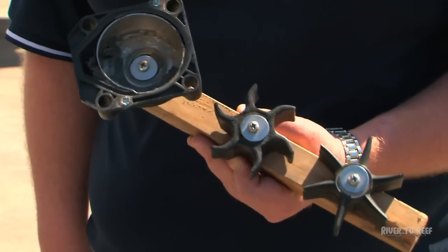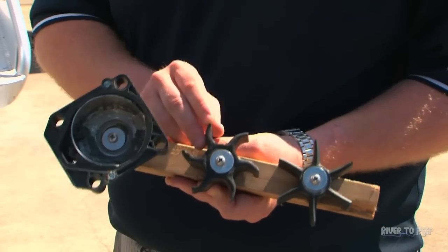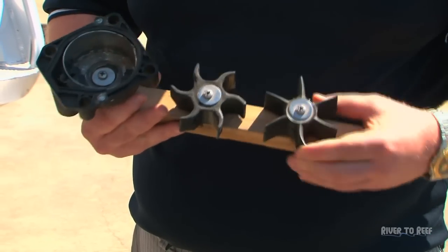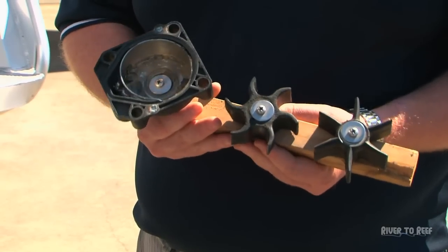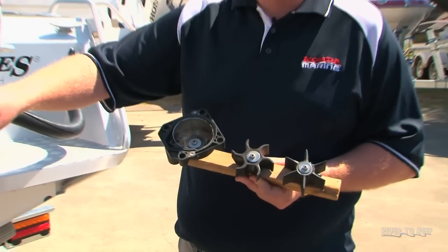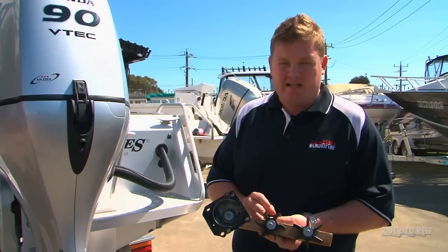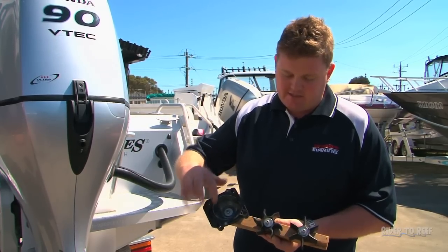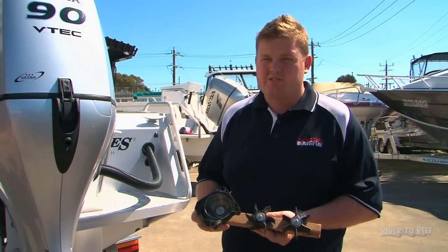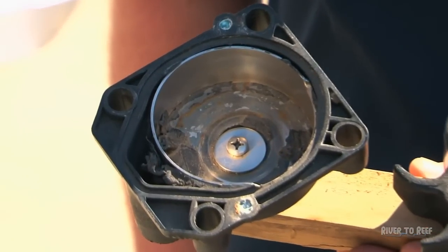You always hear stories about people never changing a water pump impeller for 10 years, but that's fairly naive. A lot of people don't understand — the water pump impeller is just a rubber component. Here's a new one; when they're new they're quite flexible and sturdy. What will greatly damage your water pump very rapidly is lack of water. Make sure when you're flushing the engine you have a good constant flow of water coming out of the telltale — if the water's not coming out, stop the motor immediately. Running without water, the rubber impeller in a stainless steel housing generates a lot of heat very quickly and can do major damage within 30 to 40 seconds, melting the inside of the housing.